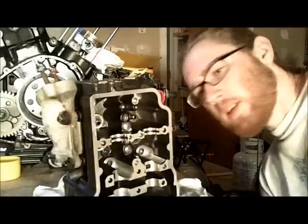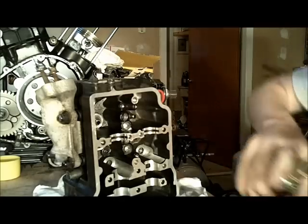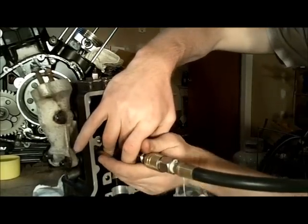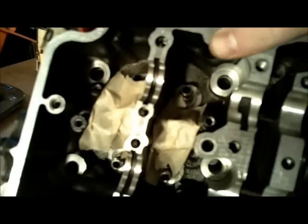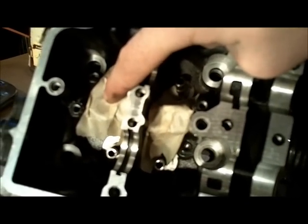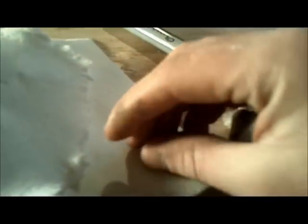While I wait for the oven cleaner to do its thing, I'm going to try and blow this oil filter out of here with some compressed air. I think if I blow in one of these HLA holes, I should be able to pop it out. By putting masking tape over the HLA holes and blowing in this little port, I managed to pop the oil filter out — a hard, porous little puck popped right out of there.